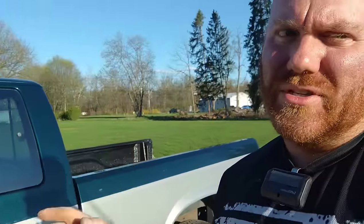I did two. Third coat on any paint, whether it's clear coat or single stage, it just gives you that extra cherry on top, that extra little bit of gloss, that extra little bit of smoothness. But it can come with additional problems, solvent pop, runs, things of that nature. So I try not to if I don't have to, but overall, I'm happy with this truck.